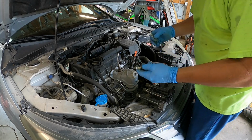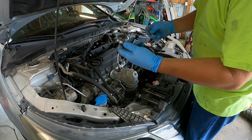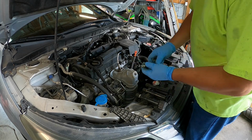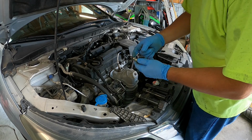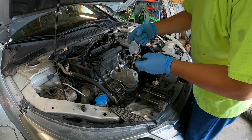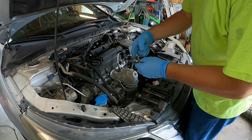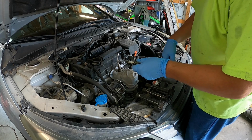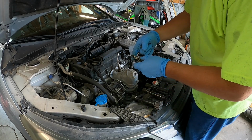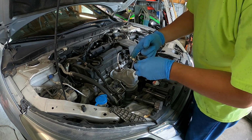What you don't want to do is, I see them do it a lot, is when I do tune-ups, I know someone's been in there before, I pull a spark plug for a reason. You'll see people do the dielectric grease, but they just put a big old blob on top and then they stick it in the boot. That's no good, because dielectric grease is an insulator. So what you don't want to do is insulate or have anything coming between your connection between the coil and your spark plug. So it's best to do it along the side right here, because it helps keep moisture out of the connection. But since I really don't do it like that, I always just put it in there. I believe it does the same thing. But I never put it right on top like that. See, that's no good. Along the side.